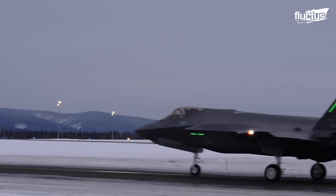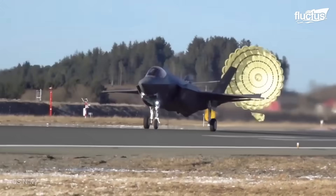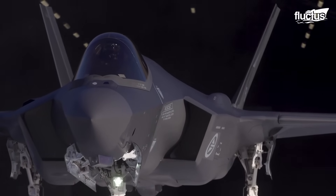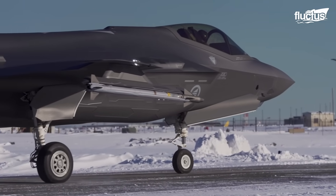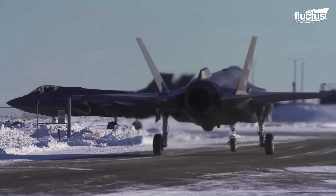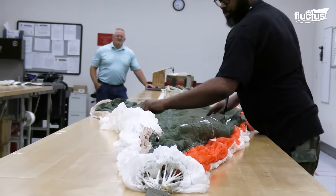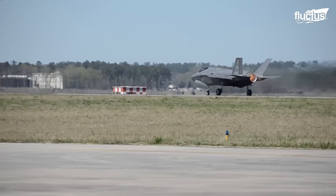In addition to the icy runway operational tests, the team conducted drag chute deployment tests as well. While none of the F-35 fighters came with a drag chute, Norwegian F-35A fighters were required to have one fitted. The unique operational and environmental conditions in Norway necessitate having a drag chute for safe operations on wet and icy runways. The drogue parachute was retrofitted to an aerodynamic pod positioned between the two vertical stabilizers, designed to keep the initial radar cross-section unharmed and maintain the stealth of the fighter. The chute is made of Kevlar and can be released from the pod with a push of a button from the cockpit; upon decelerating, the same button is used to detach the chute.